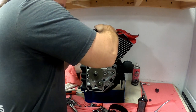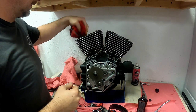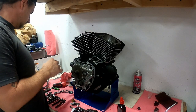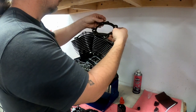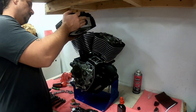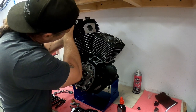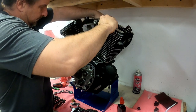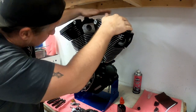Hold down the front cylinder when you push the rear one down too — they make tools to hold it down. I'm cleaning up the excess oil on top of the piston because it can cause it to hydro-lock if you first turn it over. Now we install our head gaskets, making sure we have the proper orientation — they only go one way really. Install the heads, indexing them onto the dowel pins of the cylinder. Watch out because the gasket can get in between the dowel and the cylinder head. You never want to use any force installing these.